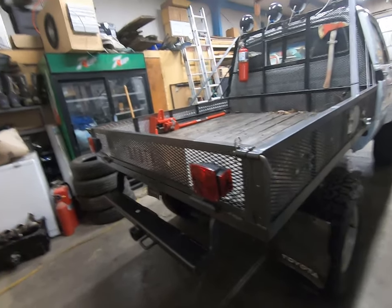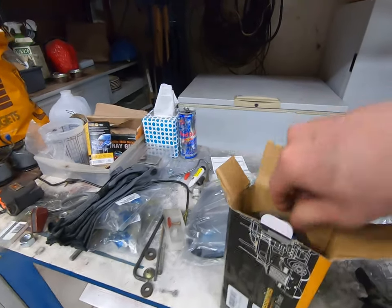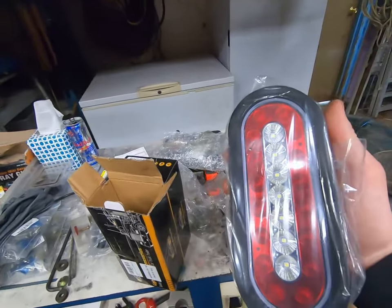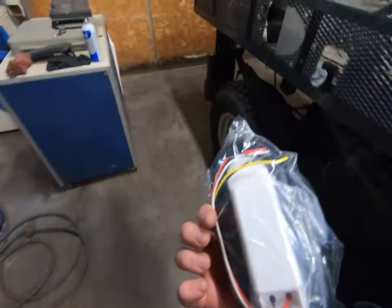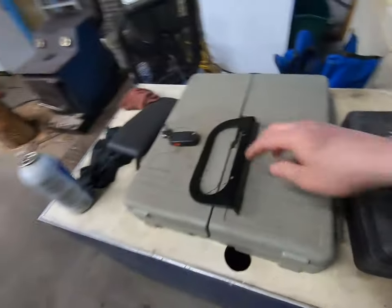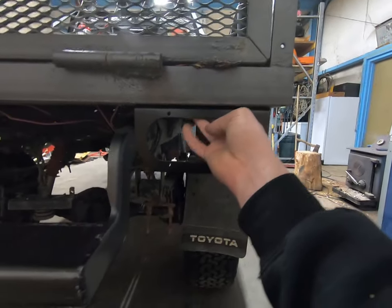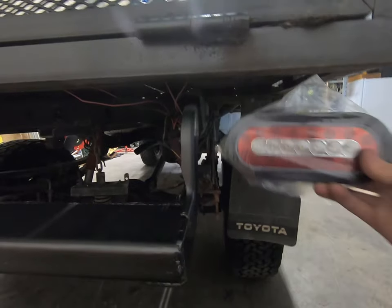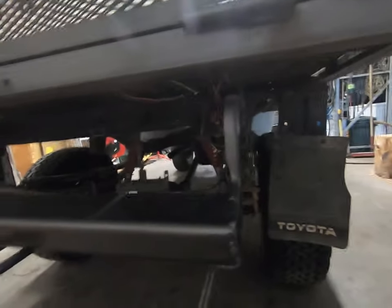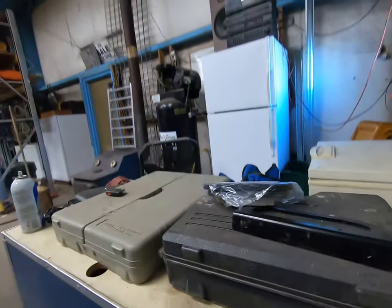What I'm going to do is I bought some 6-inch oval trailer lights — just LED truck lights that have reverse in the middle of them, plus tail, turn, brake, and reverse. I'll be putting those on. I got these brackets here. I'm going to put these on under here and then put the lights in and get them wired in. I'm going to have to do a four-way trailer wiring plug on these, because the way that the Toyotas are wired, you have to do that to make a single light like this work.